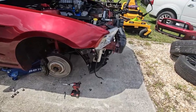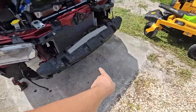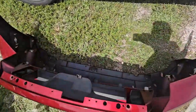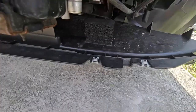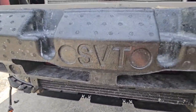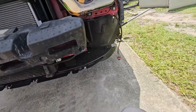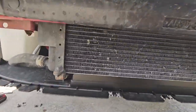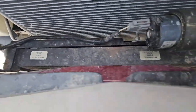Actually, I was wrong — I forgot there are no 10s there; I was thinking of the old 99–04 body style. So the bumper just pulls out. You need another couple of 7mm bolts all the way across the bottom that attach the lower splash shield to the inner splash shield — there are like 10 of those. Also note the SVT front bumper absorber; pulled all that off so now I have full access.